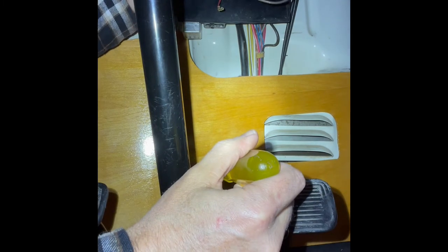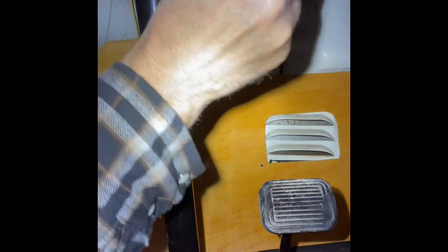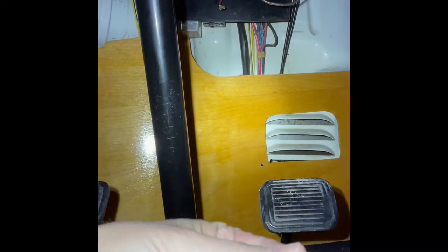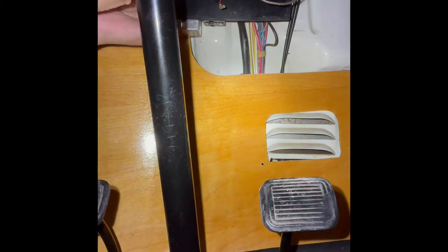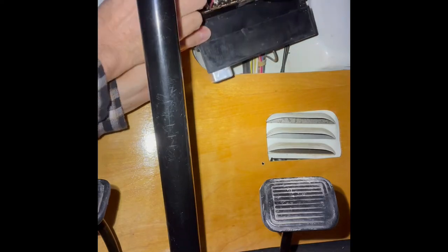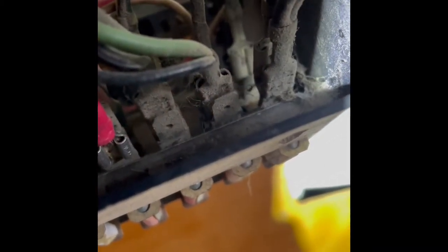It's really difficult, not impossible, to attach wires to the top of these fuses without taking the box off its mounting. There are two screws — one here and one here. Now you can tip the box back and move it a little bit to gain access to these connections at the top. As I pull this back further, there's an empty spade connector on that second from the right, number 11.